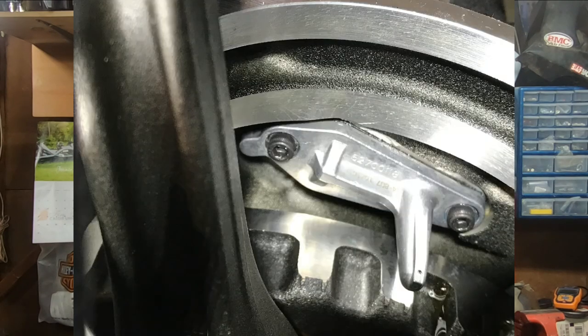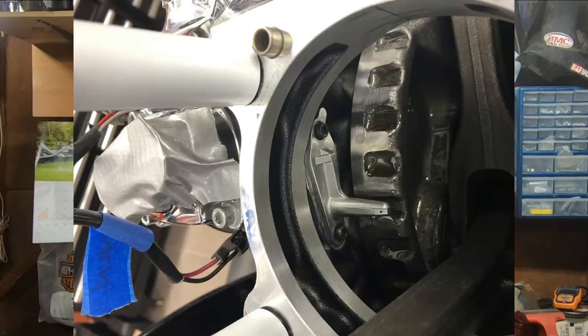Another cause of oil sumping can be the piston oil jets. If the gaskets are leaking, if they're actually loose, if the check balls fail in these things, these can actually dump oil back down into the crankcase and pretty much just flat out overwhelm the oil pump, and it just can't scavenge that oil back to the tank and keep that flow and that balance through the engine going the way it should.